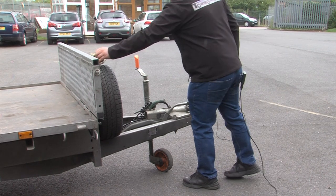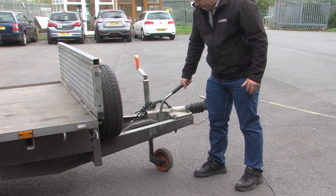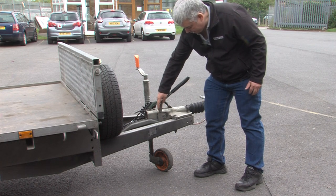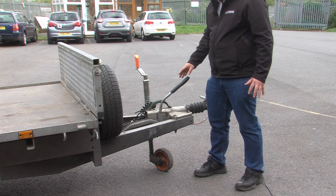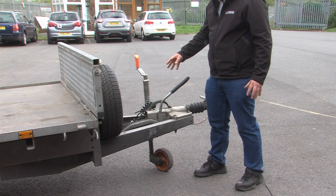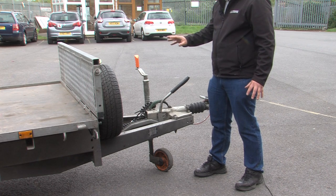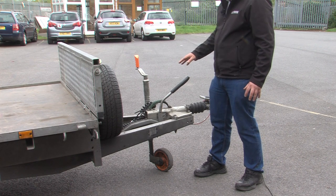The next check on a brake trailer is to pull the handbrake on — it should go approximately 90 degrees to the body. If it goes up further, it can mean that the brake adjustment is out, or that there is nothing within the brakes. If the handbrake comes up to that amount, the brakes are set correctly.